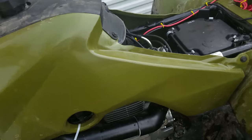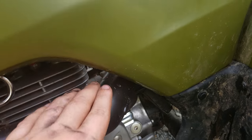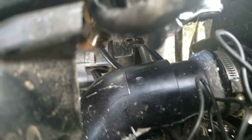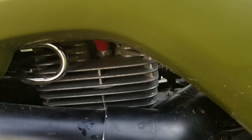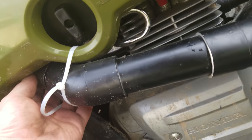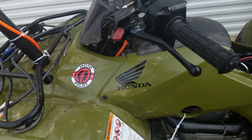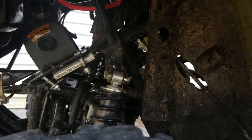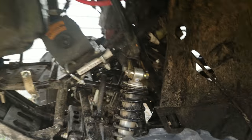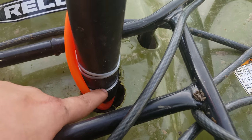You're also going to need two 45-degree fittings. You'll have one little piece of pipe come out, then a 45, then another 45 right there, then a piece of pipe and another 45 up under there. After you run that 45, you come under here, put a couple of 90s, move it up, then drill your hole and come out roughly right about here if you have the same length of pipe.